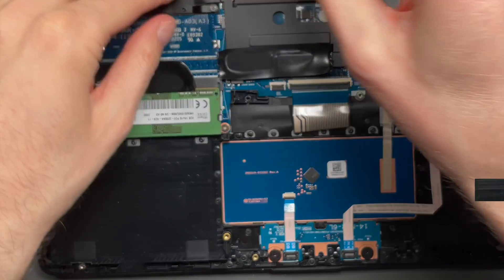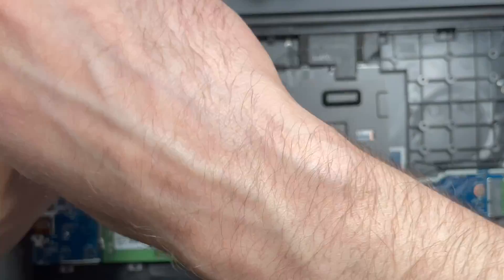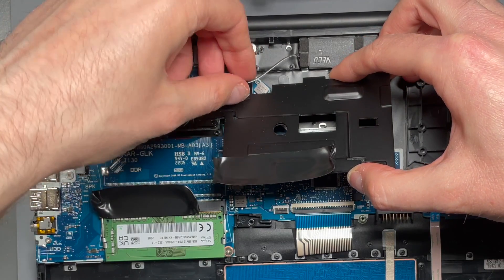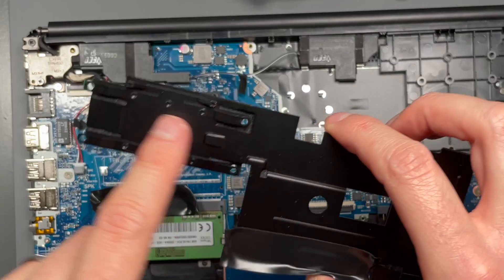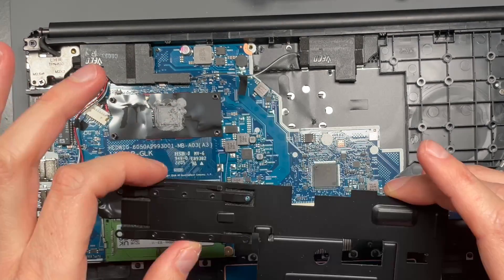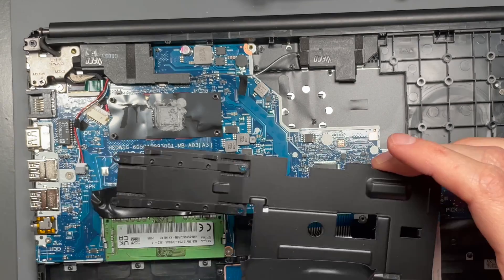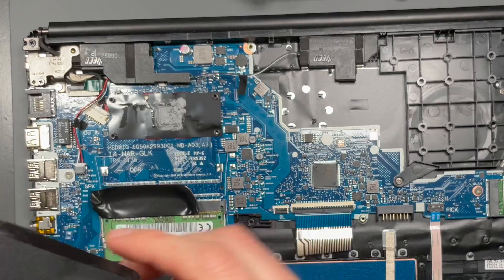Let's get back to the upper left and take this off. There's a little connector here for the left speaker that's taped on. They've got a mica sheet that goes to a little metal heat spreader, but it is using thermal paste. It doesn't get very warm. Here's the heat sink basically — it does have thermal paste between the processor and the heat sink. It has a mica sheet that it interfaces with, and that mica sheet is then coupled to — I think this is aluminum — which is interesting because the Highbook used a massive copper heat sink.